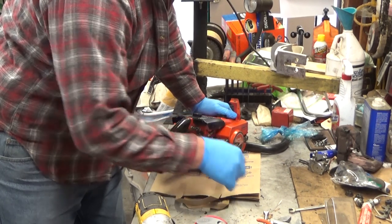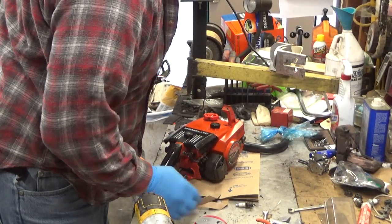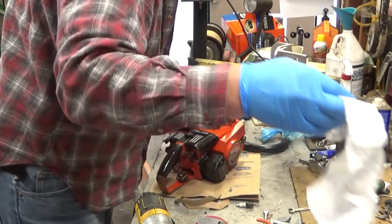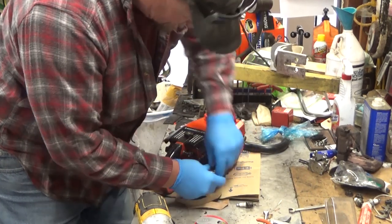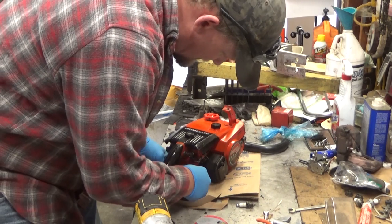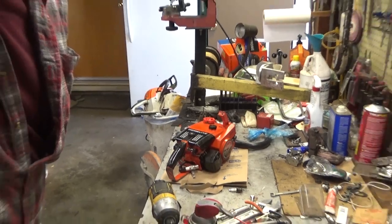Now, I'm not going to use the plug. I'm going to use my, wherever I left it, maybe. There we go. We're going to use the bigger spark tester here, because if it'll jump that gap, we know that it's good. So let me get you zoomed in, and I'll tilt this a little. Oop, didn't go. There we go.